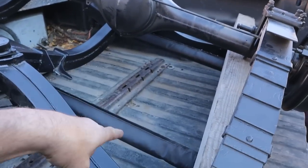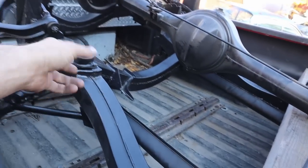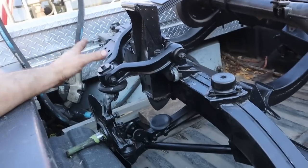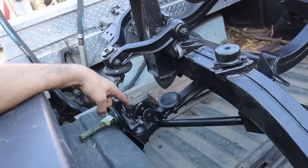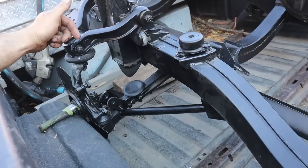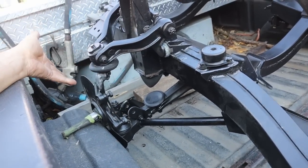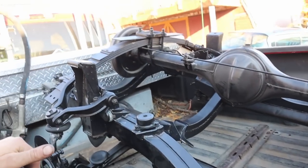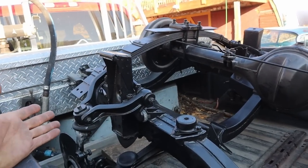All right, excellent day today. We've got the diff and front subframe for the Rover here, so we can have a look at that. Fellow Chrysler enthusiasts might see a half subframe, half a C body with torsion bars. Struts are behind instead of in front, but otherwise, very familiar to anybody with a Nova, Camaro or C-body Chrysler. Colin has gotten this all redone, so it's looking very good.